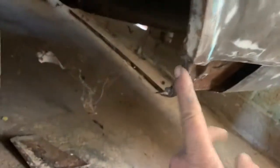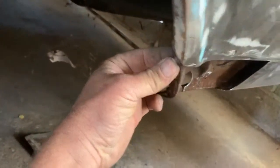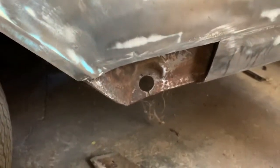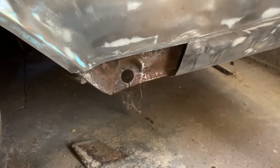I'm not going to put it on the faces where it's got to be plug welded or spot welded back together, because you won't be able to weld through it. I'll hit that with weld through primer instead. I've got some nice bronze weld through primer that I'll use for that. So I'll coat that up and I'll see you tomorrow night.